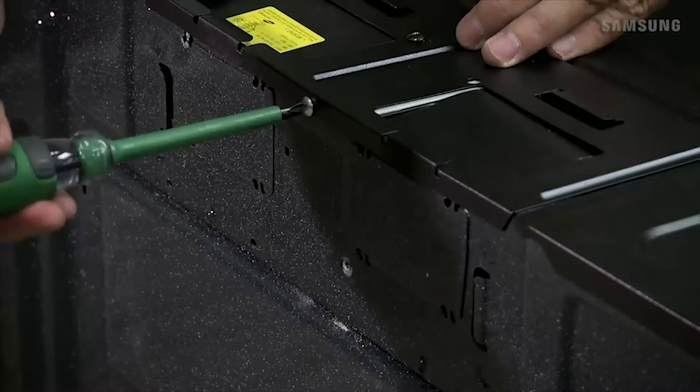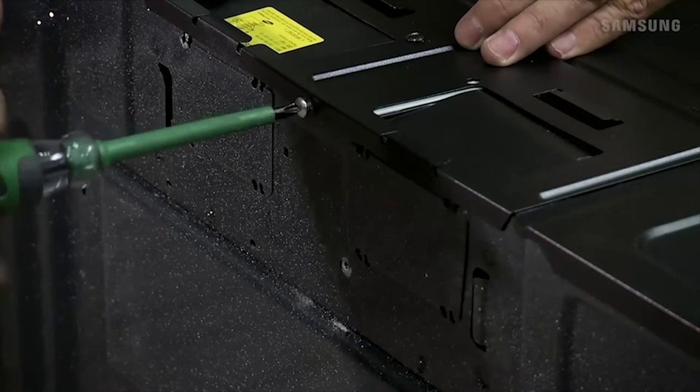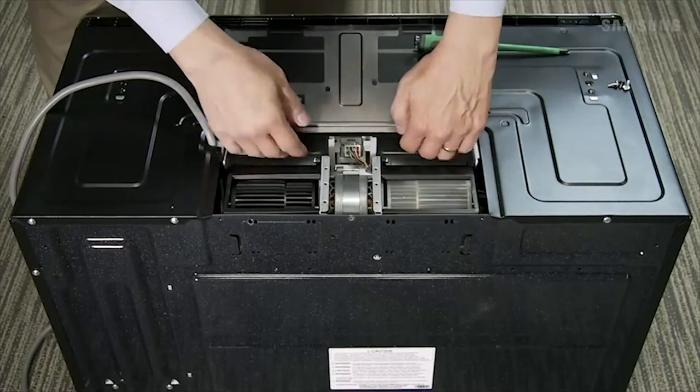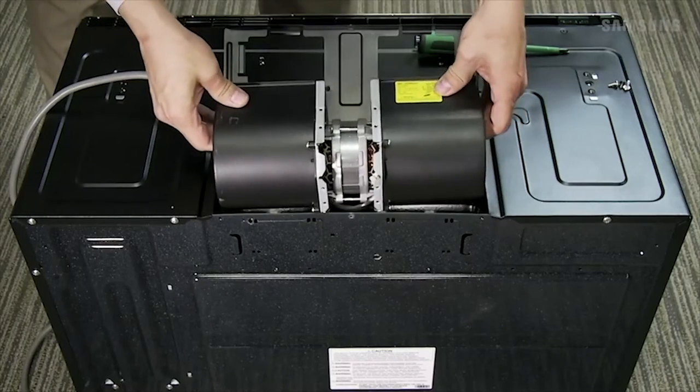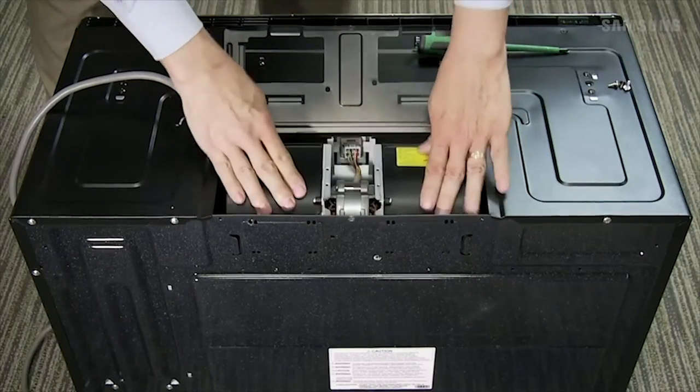You'll make the adjustment by first removing the blower plate screw. Open the plate, remove the blower, and rotate it to your desired ventilation direction. And be sure the vent pipe has no obstructions that block airflow.